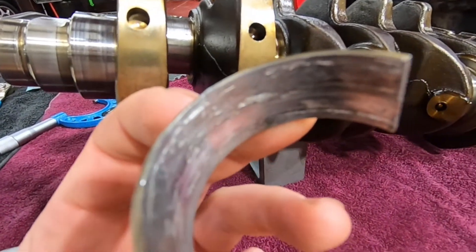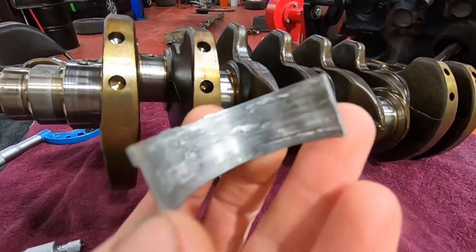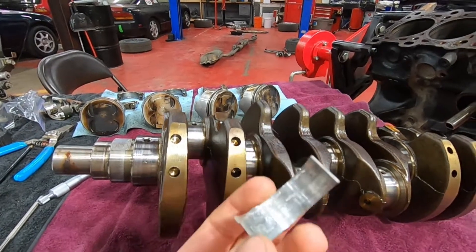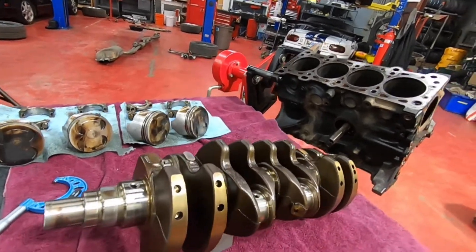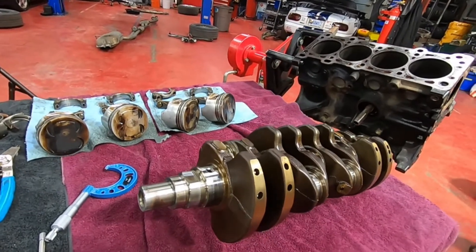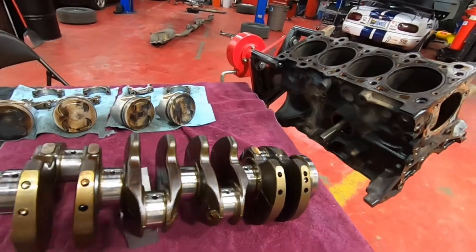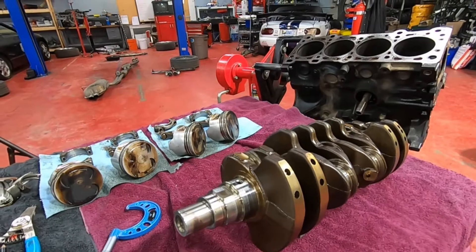But we found a little bit of glitter in the oil, and so not surprisingly when we got it torn apart, we found some damage to the bearings. This is one of the bearings from the connecting rod — you can see there's some damage there, and there are even some little pieces of it missing. So that gave us even a little more concern about measuring the crankshaft, making sure everything was still in spec, and then measuring the block as well before we decide how we're going to remedy the situation. We'll show you how to get some basic measurements which will give you a clue to what's going on and how to proceed.